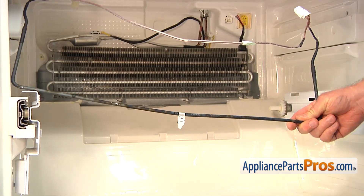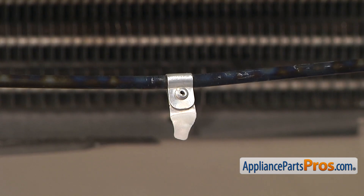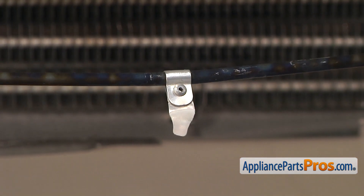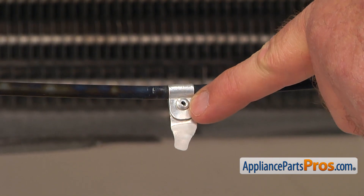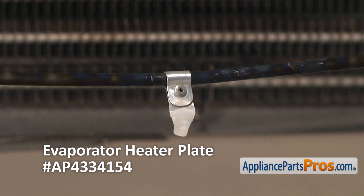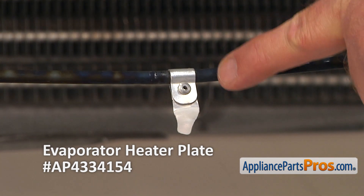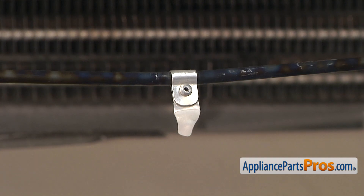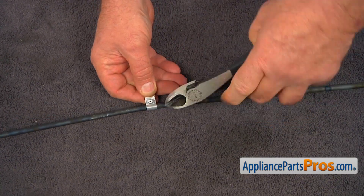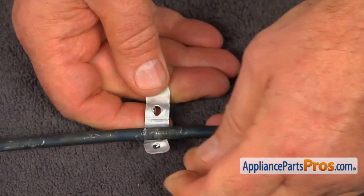Now I'd like to point out one detail right here. This is an aluminum strip, which is like a condensation drain defrost heater. It transfers the heat from the defrost heater into this opening at the bottom, which is a condensation drain. We can either take out this rivet and reuse it on the new heater, or we can order a new part, which is AP 433-4154, widely available on our site. We're going to show you how to take off the old one and reuse it. Let's place it on the table and use the side cutters to get rid of this rivet so we can reuse it.